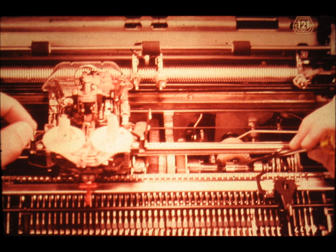If you then, with the use of a screwdriver, push the right end of the governor clutch spring top to the rear as shown here, the carrier will take off immediately. And if you aren't careful, it will knock the screwdriver right out of your hand. You better use your left hand to prevent the carrier from causing any mishap.